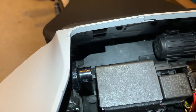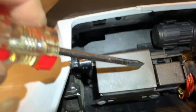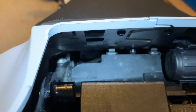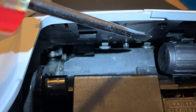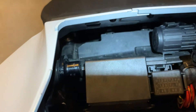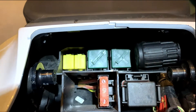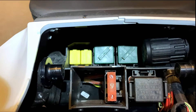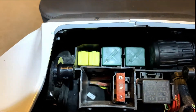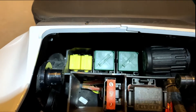To get to the relays you need to take off your rear seat and then remove this piece because it's all part of one piece that has to come off. I believe there are two tabs right there that have to be released after you release the two here to pull the whole thing out. With the cover released you can see the two relays are here. I'm not sure how my wire is going to pass between those two because the gap is really small, so I might have to do a little modification to my wire-to-fuse-tap connections.